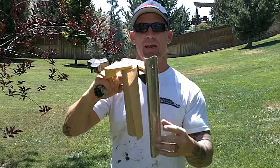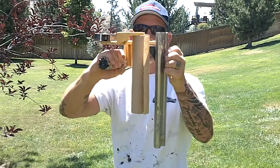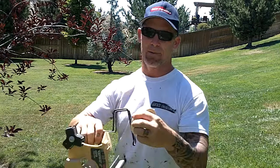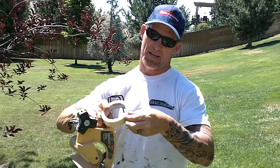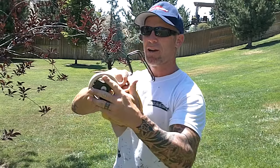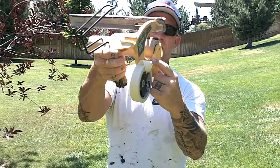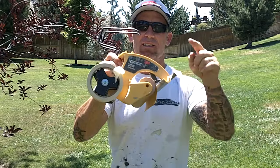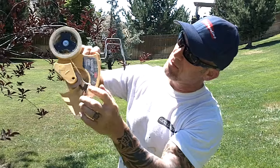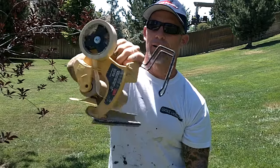Tear off a piece — you can see that blade is adjusted a little bit too high, so I'm just going to move it over one notch. Now I'm going to take my one-inch masking tape. It's the same idea — it's going to go over the top right on my 3M handmasker. There's a little catch right here with an arrow, showing that the tape goes underneath the catch, and that keeps the tape down so it rolls over the top of the paper.